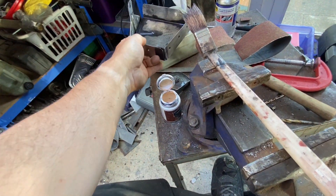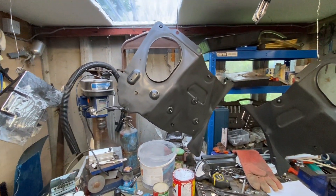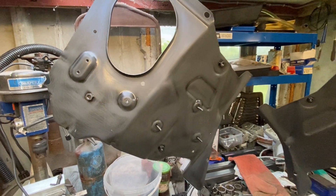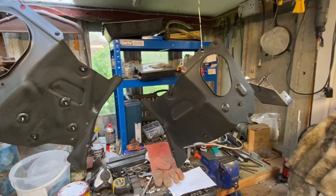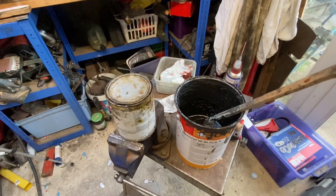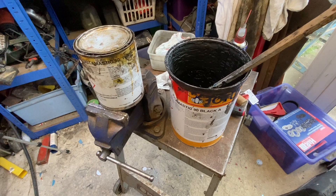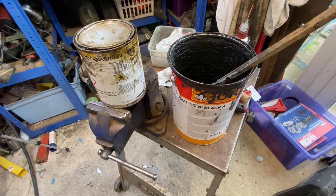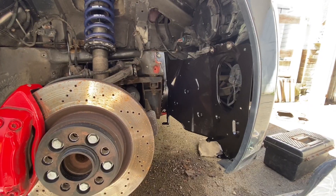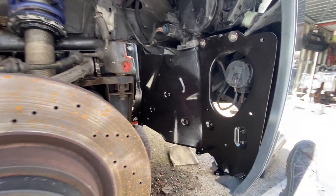Once this has gone off, I'm going to clean it all off as best I can again around those corners, then acetone, and then I've got Jotamastic epoxy. You might think I'm going over the top but believe me, rust — I've had tons of experience with rust. If you really want to get rid of it you have to get the preparation 100%. I've really got to the point where I think the best thing to have done would have been to get them shot blasted, but shot blasting is miles from here.